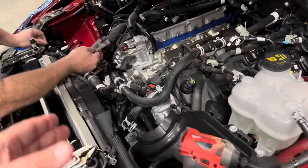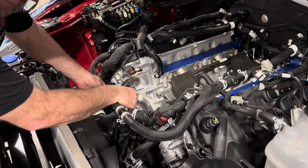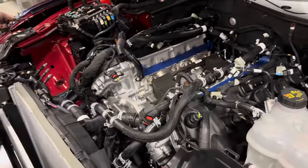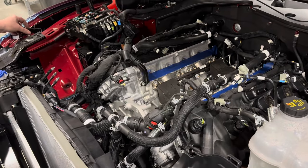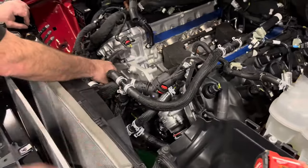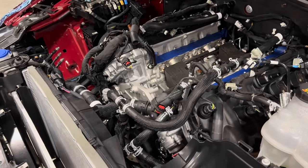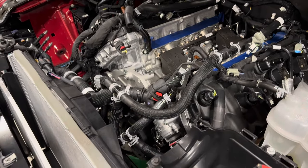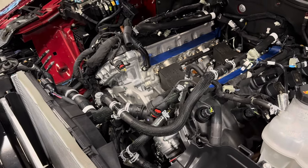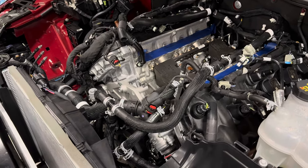What we've got here is a new bracket. If you remember in the first video, we talked about this solenoid that basically puts fluid into the transmission. Just like the F-150s, there's no thermostat in the valve body anymore — this is now a computer-controlled solenoid for the transmission. Basically, when it's under temperature, it's going to shut that off so no fluid can flow to the transmission, and once it's up to temperature, it'll open up and allow the fluid to start flowing more.